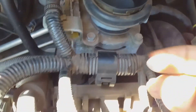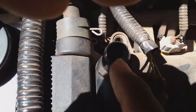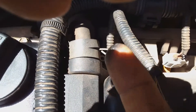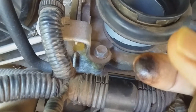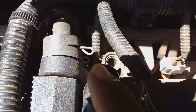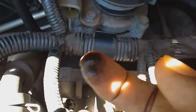This is caused by the air breather right here. This hole is where the engine breathes. When pressure develops in the engine, it releases some of that pressure through here and it enters the throttle body. That grease coming up from the air breather is what caused my finger to look like this. In some cases this black substance — the grease — will come up and go down into the throttle body.